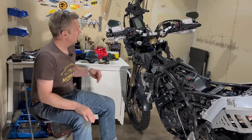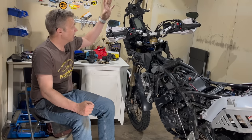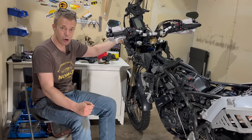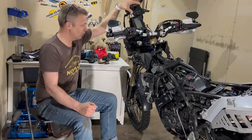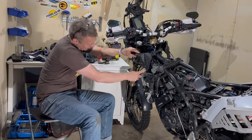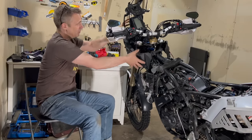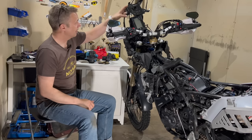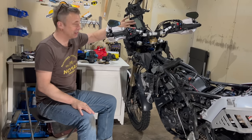Thinking if there's anything else to add, but yeah, the next project on the bike that I'm eagerly awaiting now is the new rally tower. So the whole headlight and everything here is going away, because I like to have the Carpe Iter up here, and it's 1 kilo, and it's too heavy. The whole thing here is bolted with a screw down here on both sides. That's one bolt here that has all the momentum from this wiggling up and down, and it came loose and the whole front goes up and down, and when it's tight the whole thing is actually wobbling because of that weight up there. So I don't want to move the display to the handlebar or anything.